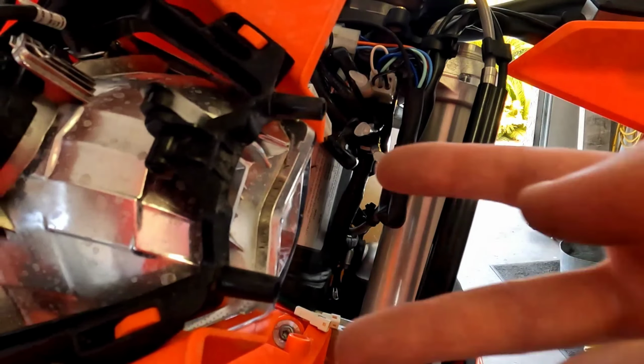When you have a washer, you have what's called the cut side. And if you look at them closely, it's going to be hard to see on these little ones, but there's a side that is more rounded, and there's a side that's more flat, has a sharper edge to it. That's what we call a cut side. Normally, in most installations, you put your cut side to your equipment or your part, right? And then your rounded, more finished side is the side that you correspond with the nut. So I go ahead and put that cut side of the washer toward the fender. Get that nylock nut with the nylock portion away from the bolt.